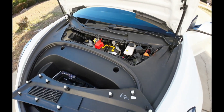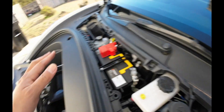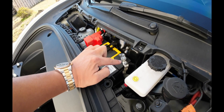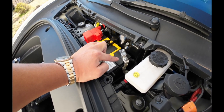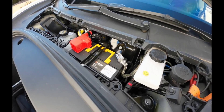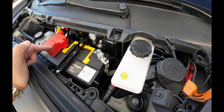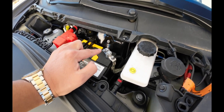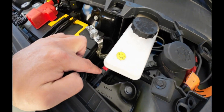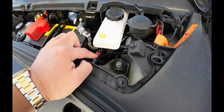This is very important — this is for the heat pump Model 3. With the heat pump Model 3, once you take the cover off you'll see the battery right there. Very important: you want to take the negative cable off first. Wait 30 seconds until the climate systems are completely off and the vehicle is powered off, then use a 10-millimeter socket to remove the negative battery cable. Once removed, you'll see the main safety switch for the high-voltage disconnect right beneath the brake fluid reservoir.